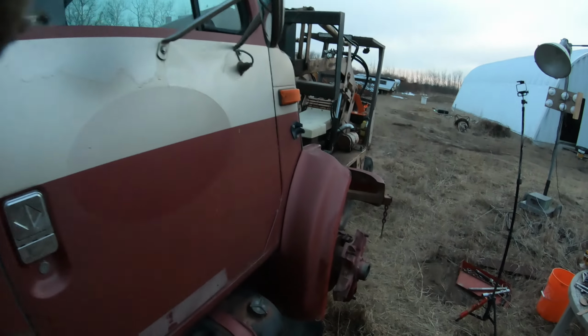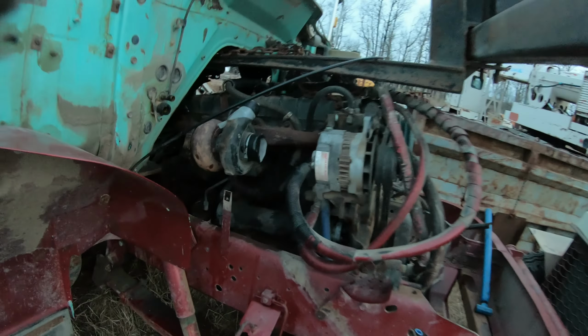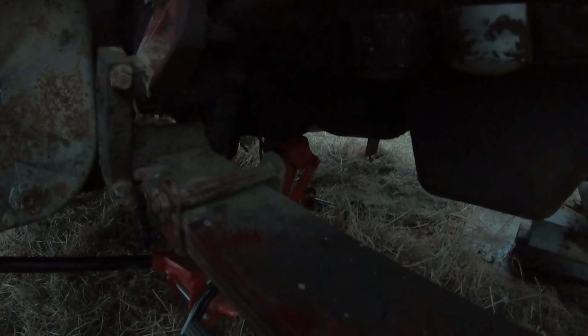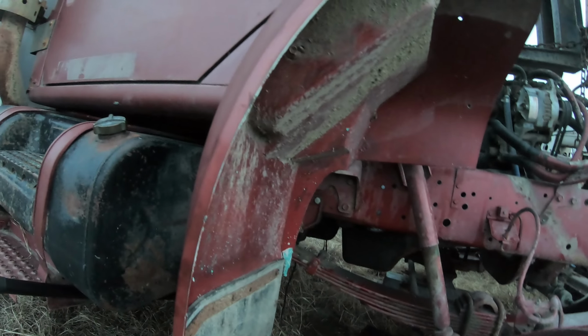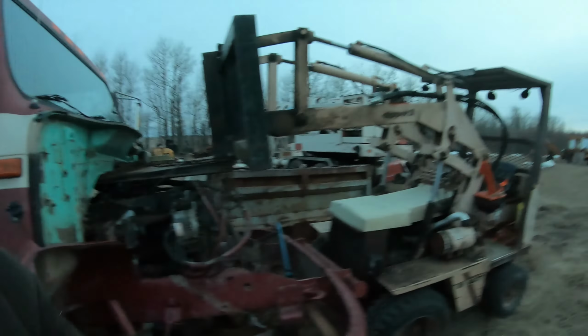I think what I'll have to do is jack up the back of the transmission and then just pull it ahead till it gets past. Okay, I got it jacked up high enough that the mount can slide over the engine mount, or the one side of the mount can slide up over the cradle for the engine mount. And I took the top of the jack off, so hopefully that can slide along the bottom of the transmission, at least a little bit anyway, just to get it over that engine mount. It's probably just gonna flip the jack over, but we'll see. Okay.